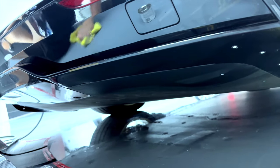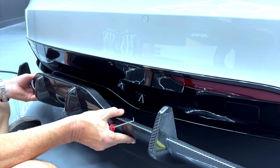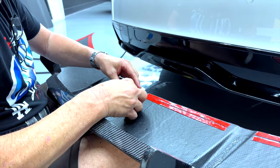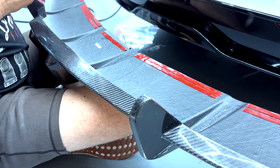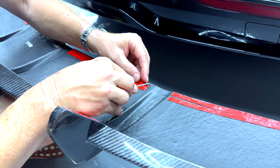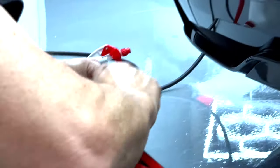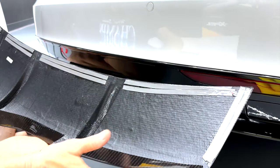Now we're going to peel off the tape. We're going to plan on securing it on top and then underneath. The first thing we want to do is peel all these little pieces of tape, because we're going to stick these on. Make sure you're only taking off the tape liner — not the red tape, just the red liner. Then we're going to take these off and we'll show you our little trick for perfect alignment for the top base ledge piece. We've taken all the tape off, including the bottom liner. So now we have a nice big piece of carbon fiber with tape.